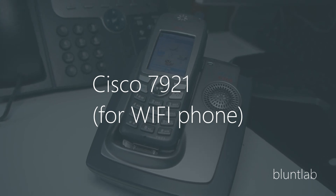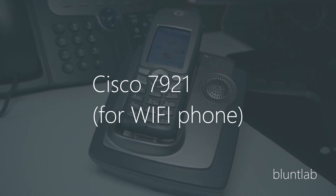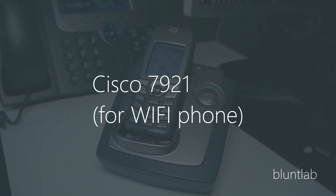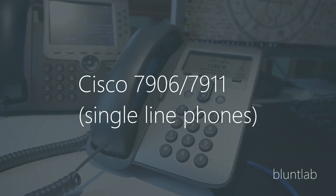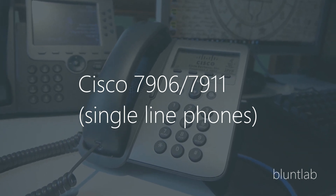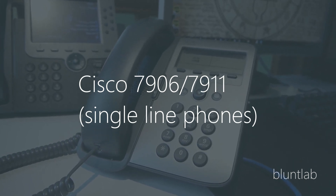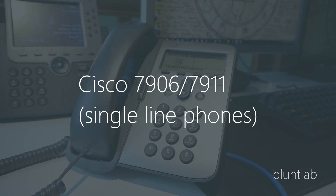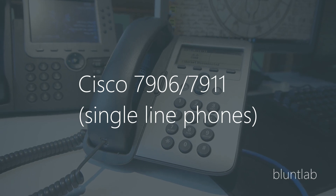If you want something wireless, there's also the 7921. It's quite easy to set up and it uses Wi-Fi. It works best with Cisco Wi-Fi gear, which is what I have at home, but it will work with non-Cisco gear - you might just have issues with roaming. You could also pick up some 7906 or 7911 phones. These are just one-line phones, great for areas where you might not have a lot of foot traffic. They do lack speakerphone though, so bear that in mind. I have five of these personally, but they've been quite a pain in terms of firmware - a lot of them just seem to get stuck with blank screens until you press enough buttons.